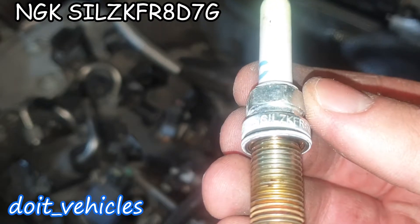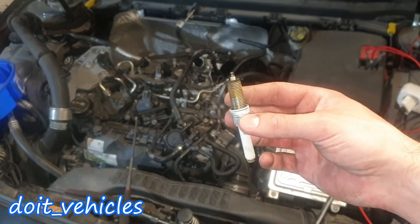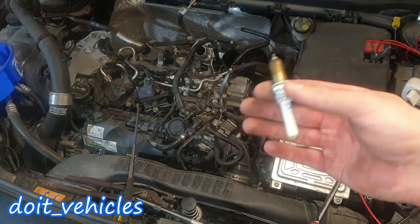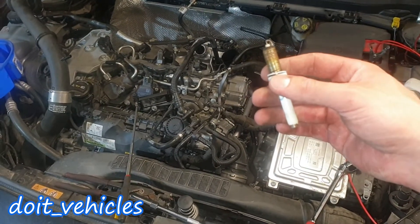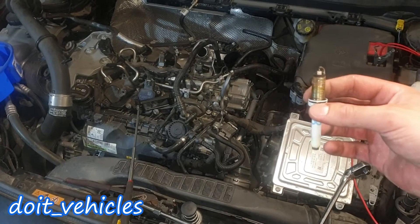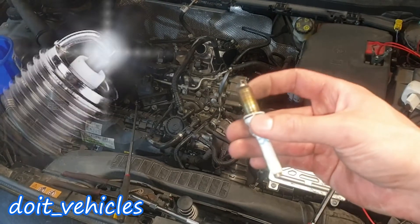Here is the name of it. For most turbocharged engines, the gap of the spark plug needs to be 0.7mm. Usually if the engine is not turbocharged, the gap can be a little bit larger — like 0.9mm or even 1mm — and that's because there is no pressurized air coming into the cylinders, so there is nothing that can deviate the spark.